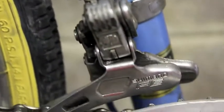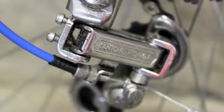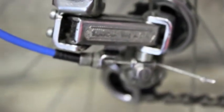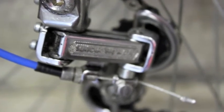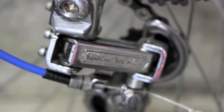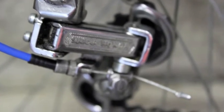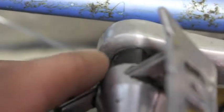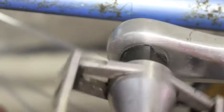Things like derailleurs can be changed. I bought this Suntour Honor because I wanted a bike with one on it — it was really cheap, so you can pick them up quite easily. I wouldn't worry too much about derailleurs. Chains and gears you're probably going to have to change anyway unless they've been changed already. Cranks — make sure they're intact with no splits or cracks. Make sure that the pedals screw on and off, because you might want to change them.